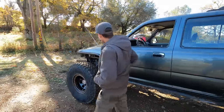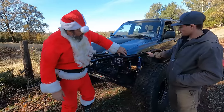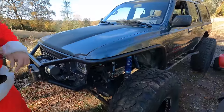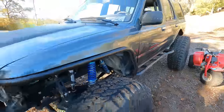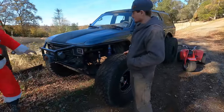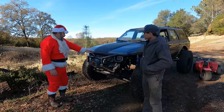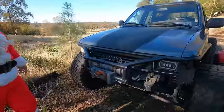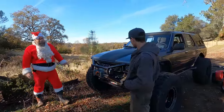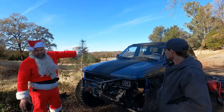Had a lot of issues with tires hitting fenders, so I did a cut up here — matched a tube to that cut, that curve, and the fender line cut goes right down to the rock slider, soon to be tied into the cage, to clear the new 40s. These are actually 40 inches — unlike the 38s I had before. Nice and tight — he actually sunk this bar into the grill, had to trim the headlights down and get smaller ones to clear this tube.